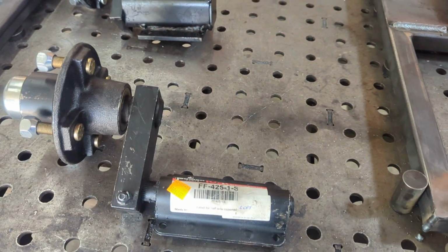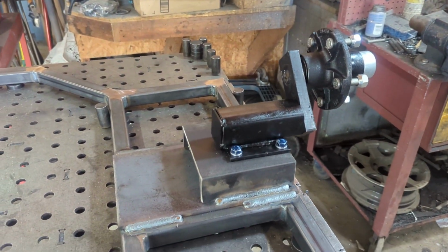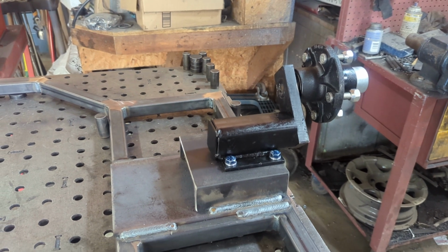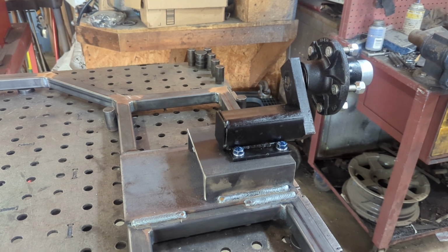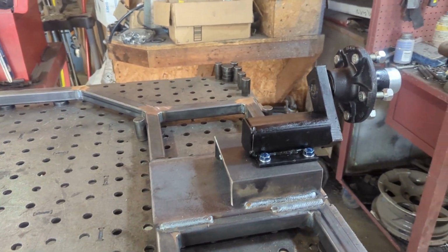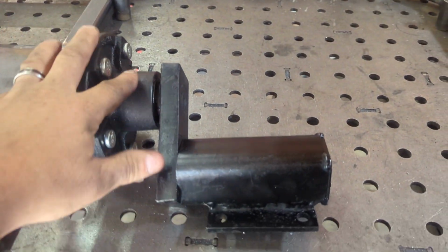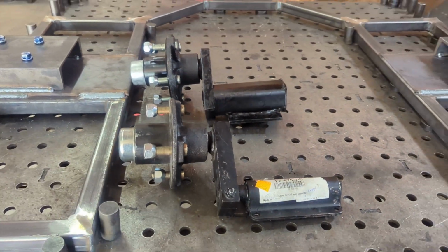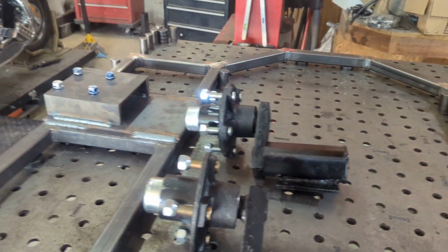We started off with these axles, and they are the Dexter torsion half axles, and they're normally 500 pounds resistant weight, but we modify them. And we went from these to these Flex Rides because they were lighter. You can see how much heavier they look. These also cost more. So here's one right here, and then here's this, and you'll notice that it's bulkier and heavier, but still a really good axle.